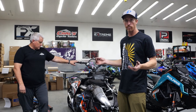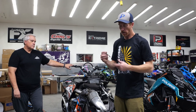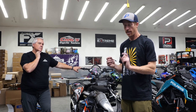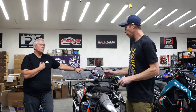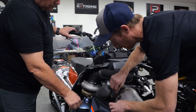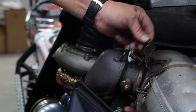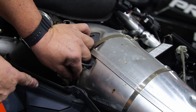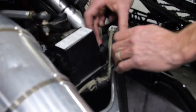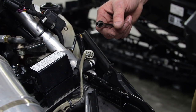On the exhaust side, especially on a matrix boost, one thing that kind of helps: put the nut that comes in the hardware kit — and this is one thing to note — the reason we use the Skins nut is because it is a thinner nut. The stock one is thicker, and because the mount on the Skins bumper is a little thicker, this thinner nut allows the bolt to get into the nylon. So it's a little tricky, but you get your bracket on there and with that nut in the wrench you can get it finger tight. Just note one more time: on the exhaust side you have a ground strap — the order is bumper, ground strap, then the nut.